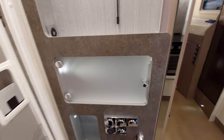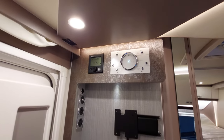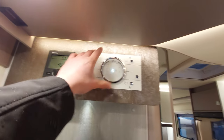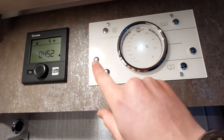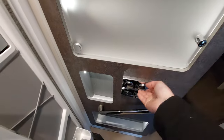So we're now on the inside of the vehicle. I've just come through the habitation door and as you walk in, you're greeted with your control panel for both your heating and the main control panel for the van itself. Firstly, the main control panel: you've got your on and off button here — this is your isolator switch — and that will isolate the battery and turn everything off. You can also turn off your porch lights by simply pushing those buttons down there.